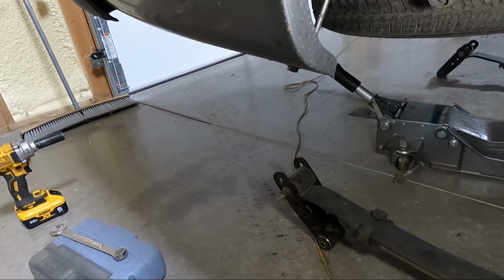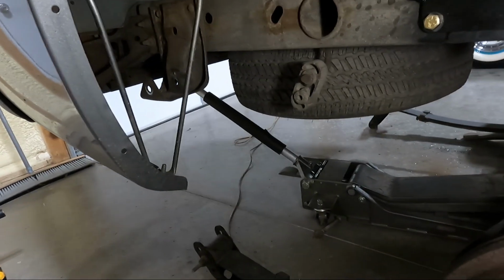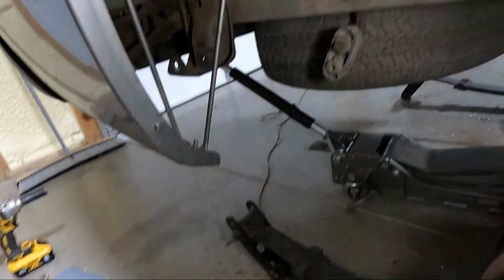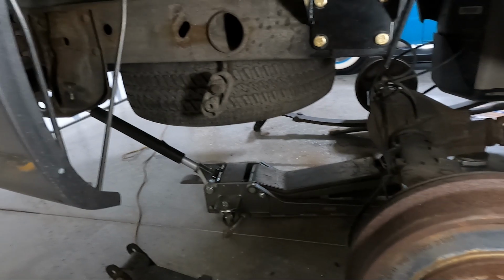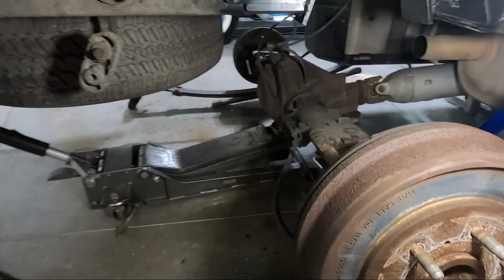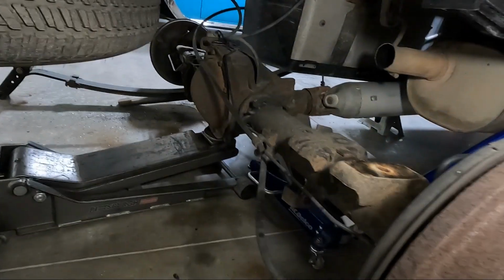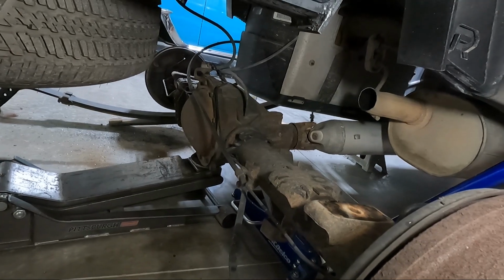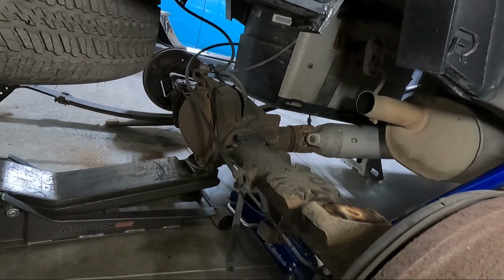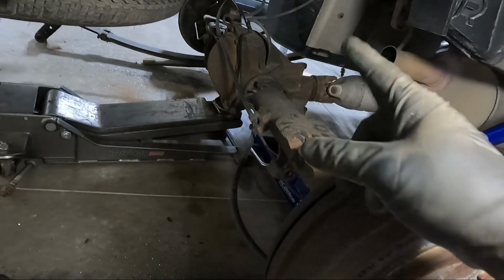And you also notice, remember I said I was going to move that up one. I did go ahead and move that up as well. So we're going to lift this thing up, the rear end I mean, and get these back into their pockets. And then we'll worry about getting the rest of the airbag lined up and the saddles underneath. The other thing is, if you don't use the other piece that comes with the airbag kit, you can see our e-brake line here. There is a piece that sets that back, because otherwise this is going to hit right where our airbag needs to be, this guy right here. So we'll do that as well.